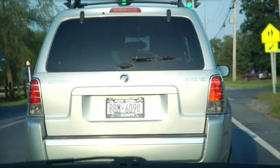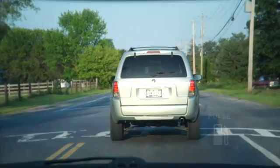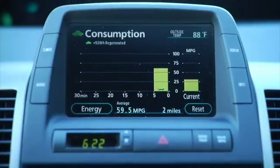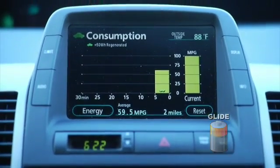You notice we're sitting here at a light — silent. We are not burning any fuel. How stupid to burn gas at a stoplight. We're going to roll off nice and easy and pulse up to speed. I'm in a little bit of traffic tonight, so it's a little bit of stop and go, which is actually good because we get more regenerative braking that way. But when you don't have anybody ahead of you or behind you, that's when you can really maximize the momentum in the road — though you do get more attentive to obstructions in front of you that break your momentum.